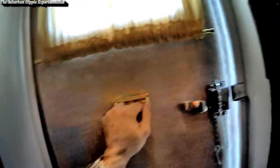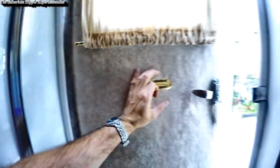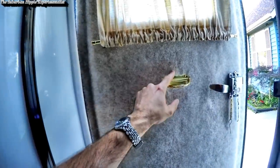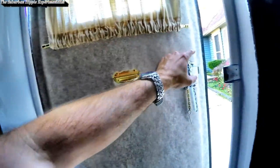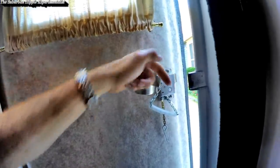They have this handle here, but it's in a real bad position to close the door — you're not getting the full force or leverage you should be able to get. The hinges are here, the fulcrum's here, and the handle is in the middle. Where you actually want to pull the door shut is right here. So I put this chain on there with one screw on the top and one screw on the bottom. I saw a guy on one of the forums that made a plate for this — he's got some cables that capture all three screws, which is better — but I haven't gotten around to making that plate yet.